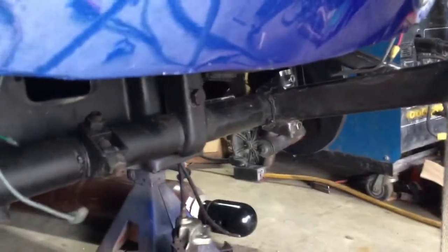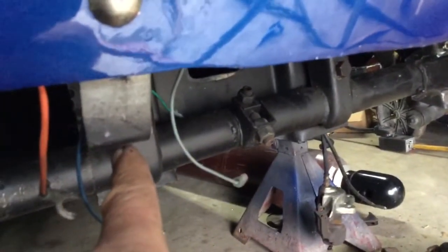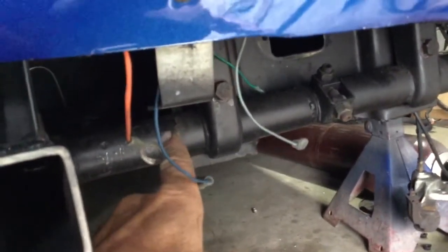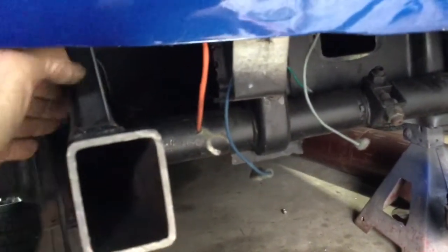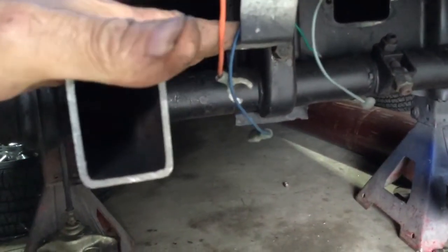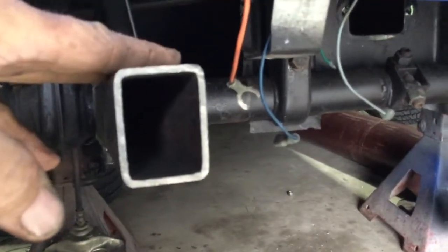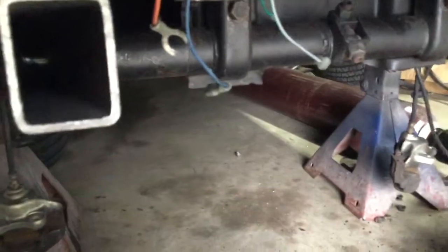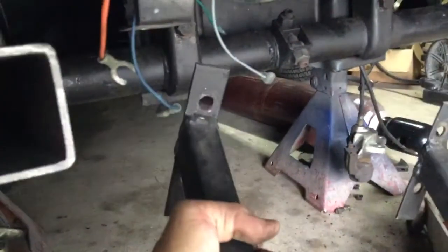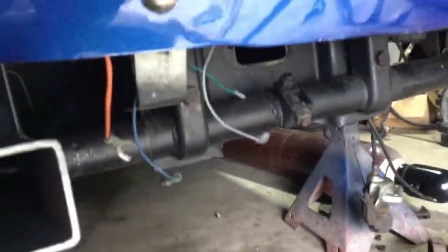These serve a purpose for mounting. The bumper can come on and off. Originally, they were right here. But that's not going to allow enough room for a radiator. So this is as far out as I can take it. It's just over 25 inches. These tabs hold the nose of the car up. So this also holds the nose in place. It used to have a crossbar in the front that went to the beam. See the holes, they went to the beam. It held the license plate and stuff. All that's gone now.